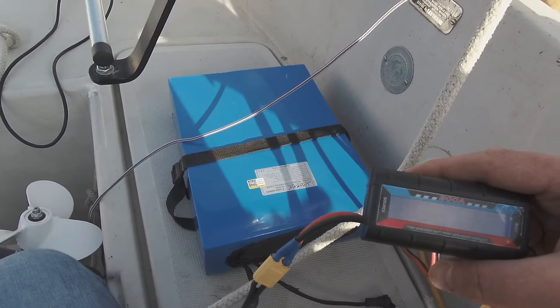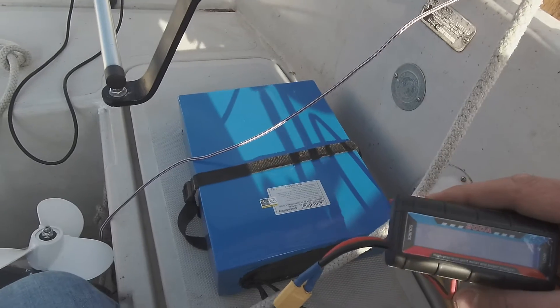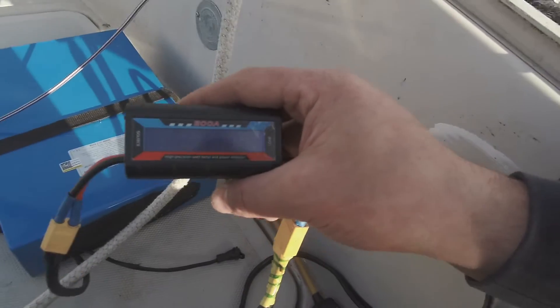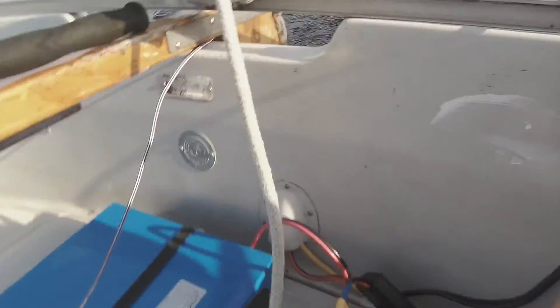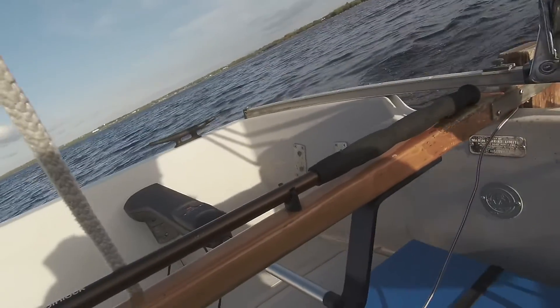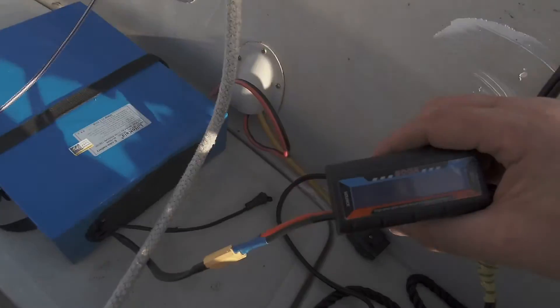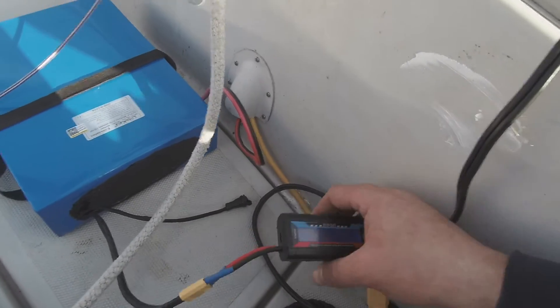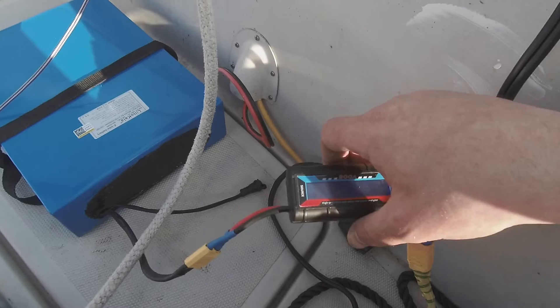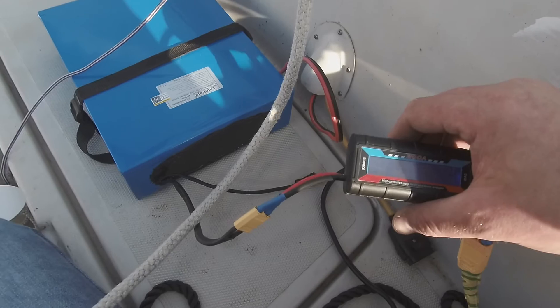I just needed to get in and out of this bay, so I'm going to see if I can get back now - because normally the sail's up and we're sailing out here anyway. So far, this one looks promising for this boat. We've sort of come down to about half-speed, so we're down to about 12 amps, 600 watts. It seems to have, like, three gears - because I can see three distinctive shifts in amperage.